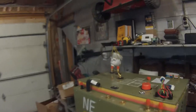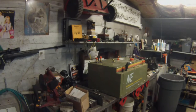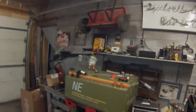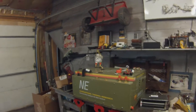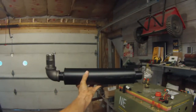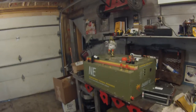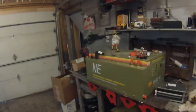This thing is flipping incredible. It's about 36 inches wide, 20 inches deep, and roughly 14 to 16 inches tall. It will fit into the bay where I drilled the holes and put the sleeves in — it'll be a snug fit. There are certain clearance parameters that have to be met, and we have that covered. The exhaust is right here and basically goes in the bottom, underneath the bay, and vents out the back of the bay down to the ground. That is the next big project: putting this guy in and plumbing it up.